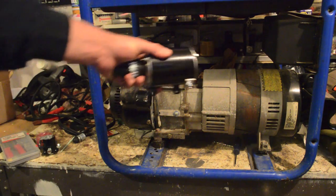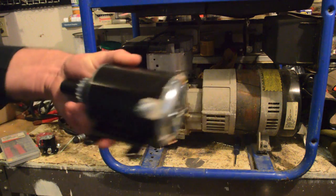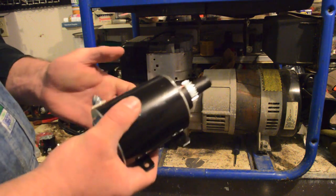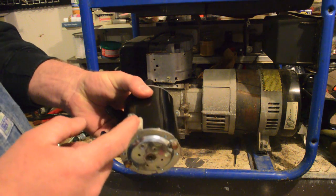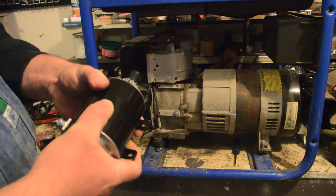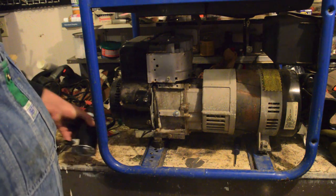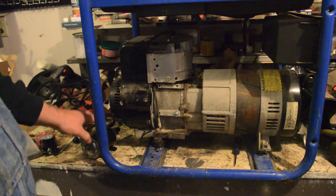Other things you're going to need are a starter motor. I got this one off Amazon for the HM100 Tecumseh engine. The positive power goes here and the negative is going to go to the engine block. Be careful — they have 12 volt starters and 110 volt starters. You could buy a 110 volt starter kit for things like snow blowers that you plug into the wall.